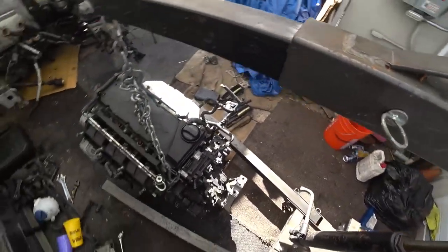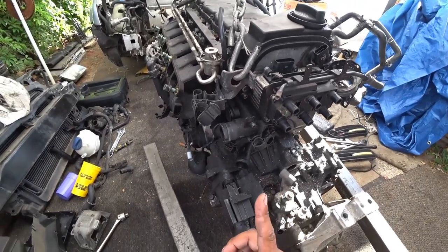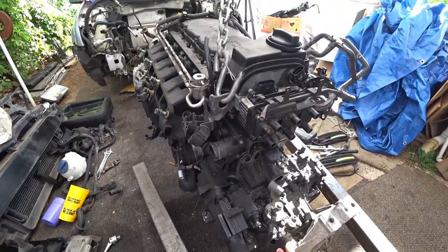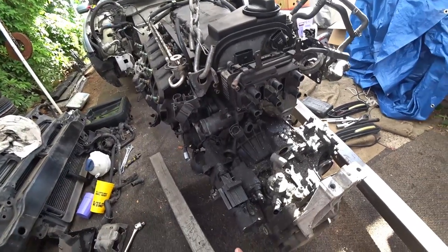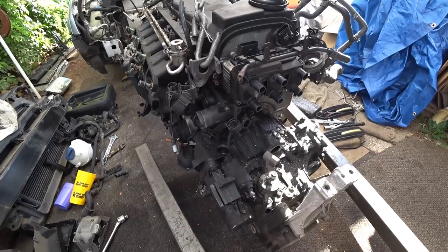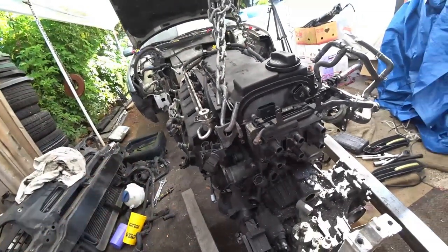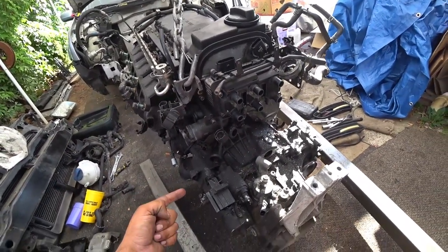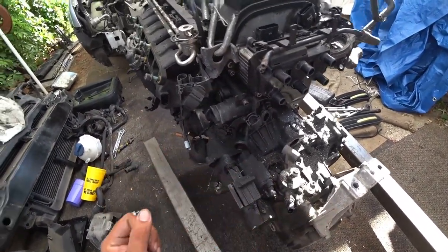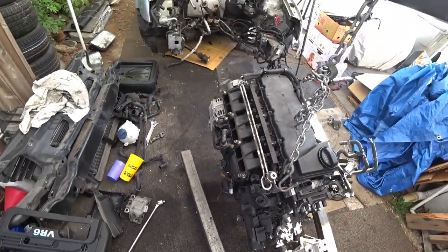So that way the transmission is not preventing the engine from turning. What can happen is that a flywheel can be damaged, or maybe a synchro is damaged. So I'll be able to move it all into gear and move the car forward and back, but if the flywheel has failed, I can't turn it but the gears are destroyed on the inside. That's a possibility. We don't know yet.